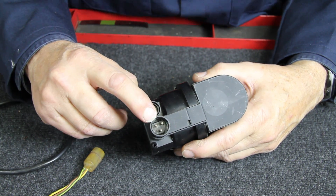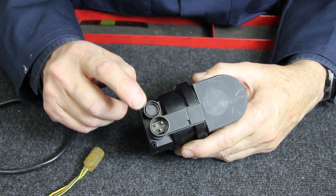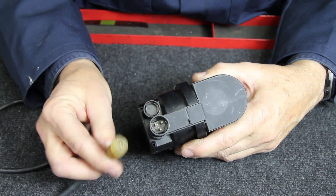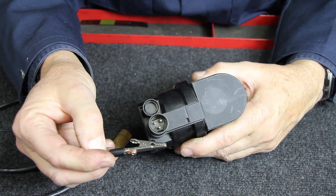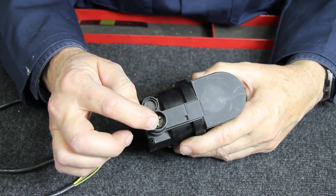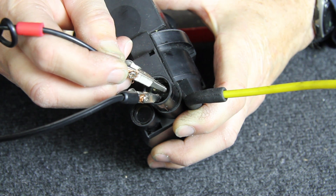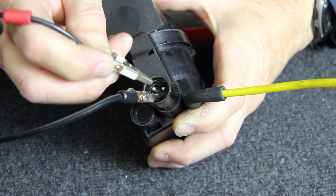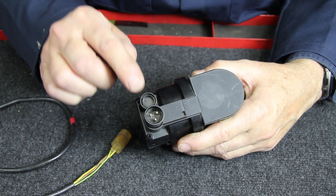Here's a close-up of the contact points in the early pump. Note there are three pins in a triangular arrangement. To test these I'm going to use an old plug removed from a parts car. If you don't have one of these plugs, you can use alligator clips to make contact with the pins, but be very careful not to contact the two alligator clips together — you're going to get some sparking. One of the pins is ground; the other two pins are for 12-volt in. Power to one pin with one grounded will make the pump run one direction and blow air; connected at the other pin, the pump will reverse and suck air. This is really important to remember as you're testing this system.